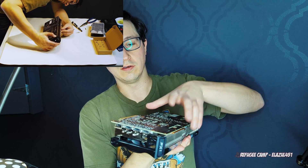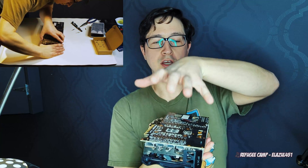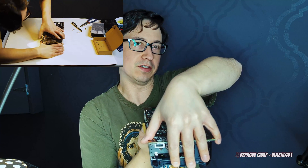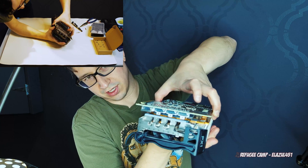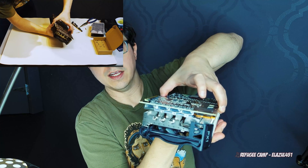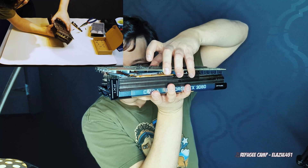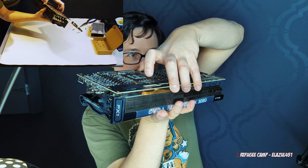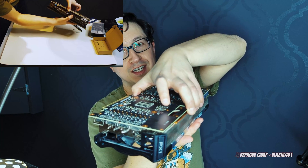While the backplate comes off with a zero-sized screw head, you will want to use a double zero to take off the back bracket. When you're working the PCB away from the heatsink, you want to make sure that you've taken off all the screws. You'll want to start from this end because there are no fan headers on this end, pull it upwards, and work your way back to the point where you're separating. As Steve on Gamers Nexus mentions, you should be at eye level with the card as much as possible so you can ensure that you are not separating anything that you shouldn't. And once you've done that, then you can disconnect the fan headers.